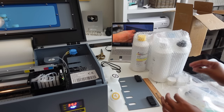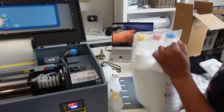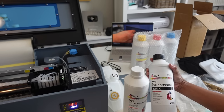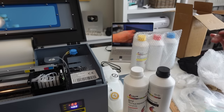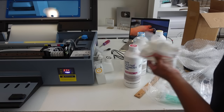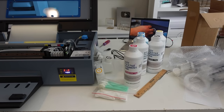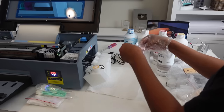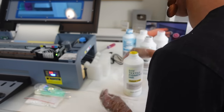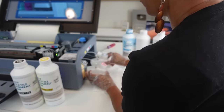Now I'm getting ready to input all of the ink right over here in the tube. No needles or anything — it just comes right out of the bottles. I have some leftover, so I'm just going to make sure it's the same ink. This is bubble wrapped really well. This is the DTF textile pigment ink — you can buy these separately as well. I'm going to use my old bottles. They gave me gloves and swabs. Now I'm going to take each ink cartridge, put on some gloves, and fill my chambers one by one. You can use a funnel to make it easier, but I'm going to shake each cartridge for about 20 to 30 seconds so that no air gets through. We want to make sure that ink is nice and smooth and flowing really good.